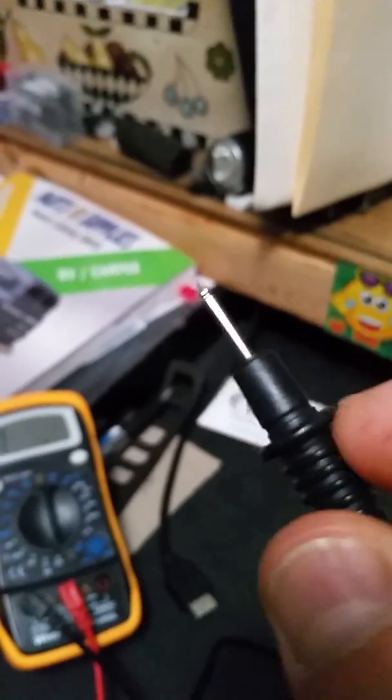The reason why you have these little bayonets on the end right here is you don't want your finger to go past this. You don't want to touch the tip while checking AC voltage, DC, or ohms — you want your fingers up here. These are finger guards; they protect you from a live circuit. Also notice right in here this little detent — that's so you can lock it on like a bare wire. See how it grabs and locks in right there? They're locked in. You can hear it lock in. That helps when you're testing AC voltage on a bare wire.